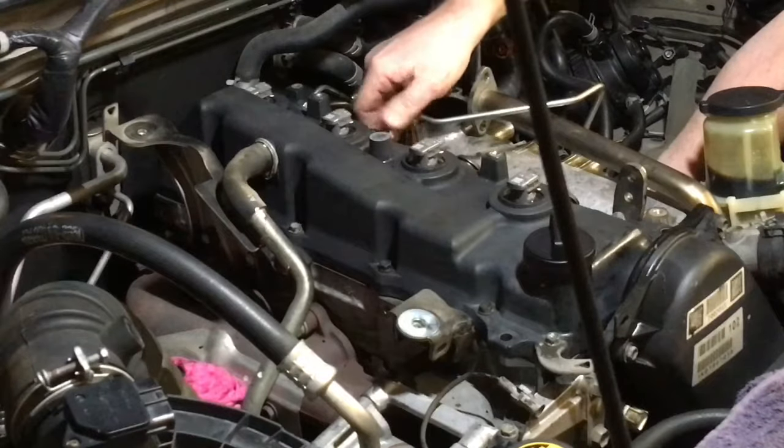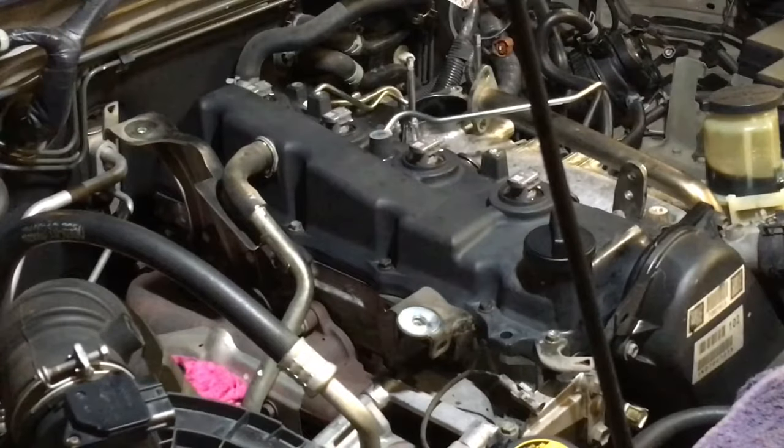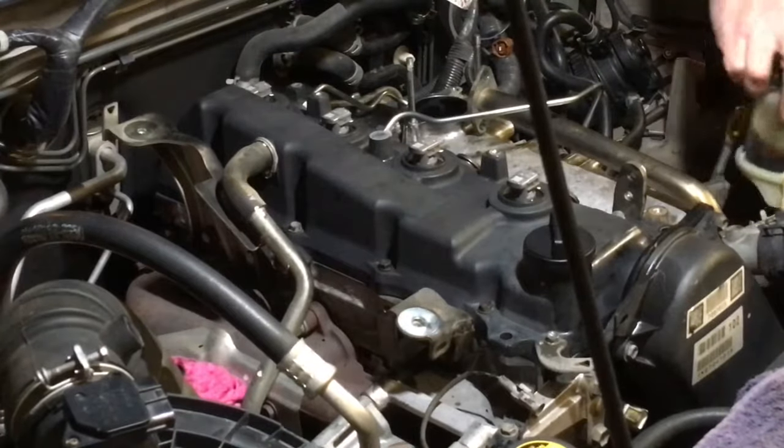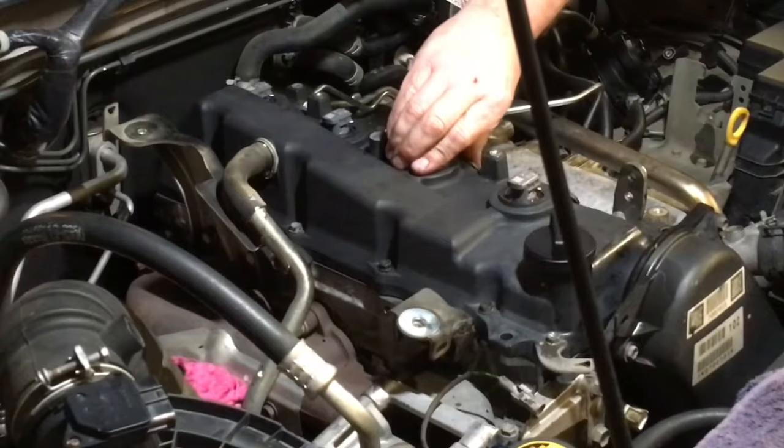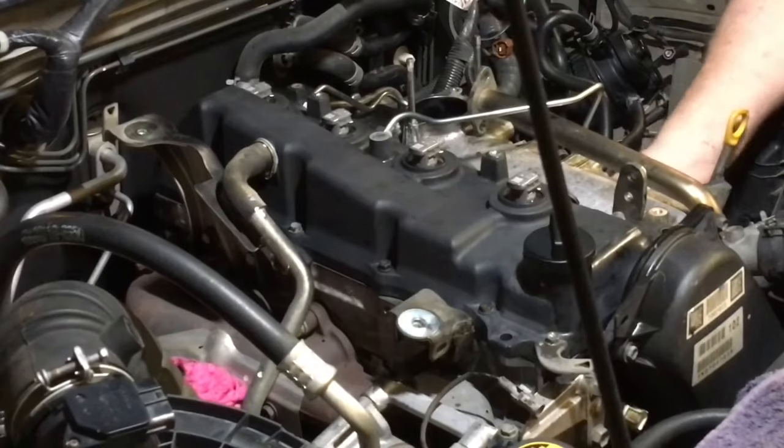What you want to do there, doesn't bother me. They can cause problems, right? So they're both done up by hand, happy days. We're gonna get number two fuel pipe. Okay, same deal. Push number two nozzle seal in now. Take the cap off.